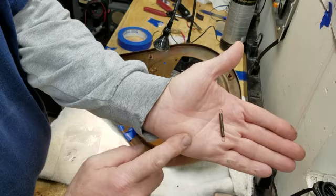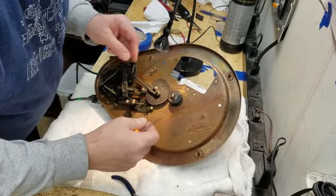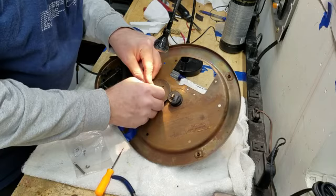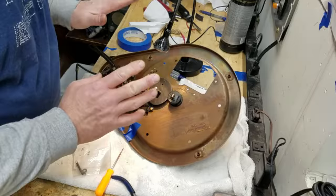There is a small clip that holds this linkage on — remove that clip and try not to let it get away from you. There's a small little C clip or E clip — I'm not sure what you call that. There it is in the baggie with the spring. There is a washer between the clip and that linkage arm — just your basic flat washer, little black washer. Go ahead and put that in there. Then I can lift this linkage off of there — just swing it out of the way.